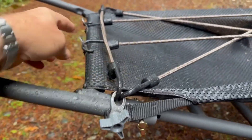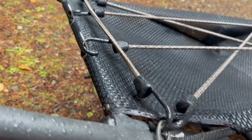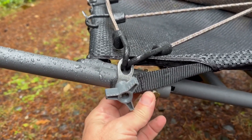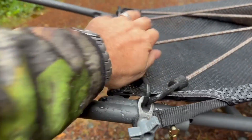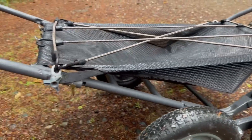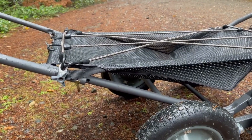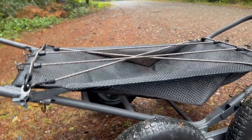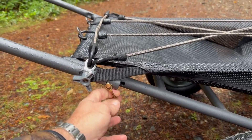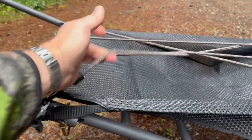Down here on the trailer you can see I've got all of these little additions — they're stainless steel and you can get them on Amazon; I'll leave the link below. They're relatively inexpensive, but I had to drill them out and pin them, because when you put a lot of weight on this — and I found that out the hard way — they will collapse. Up here in the Pacific Northwest where we're pulling out four to six hundred pounds of elk meat, it will collapse on you. I highly recommend drilling that out and putting in some pins. I went to Harbor Freight and got the whole kit for about $15.